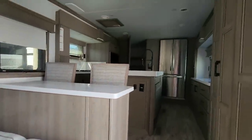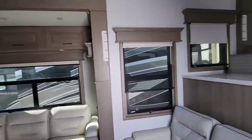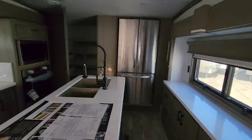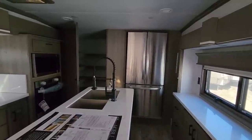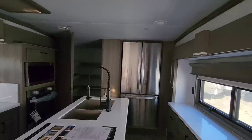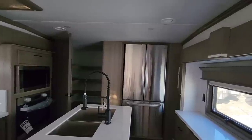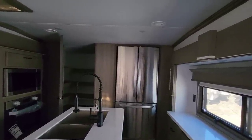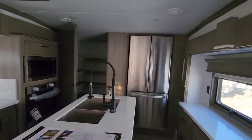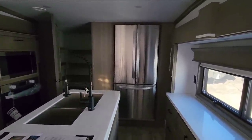This thing is huge — 9,000 pound axles, 18,000 pounds worth of axle capacity, which means your tow vehicle is going to handle a ton of weight. You're going to have to be sure that if you tow this with a pickup truck, it is the heaviest payload package version of a dually you can get, because you're going to be transferring probably about 4,500 to 5,000 pounds worth of weight to the back of your vehicle. If you don't have a truck that can handle that, you don't want to put yourself in a situation where you can't stop or control it. You may even want to look at a medium-duty truck or even a heavy-duty truck like a Volvo, Kenworth, or Peterbilt — something you can convert to handle something this heavy, because this is a very, very heavy fifth wheel.